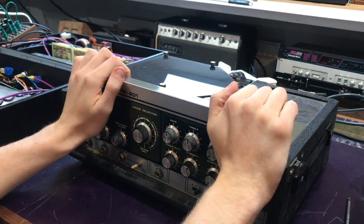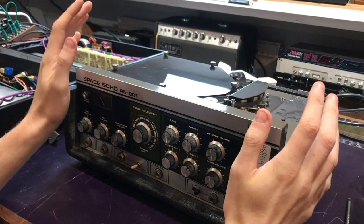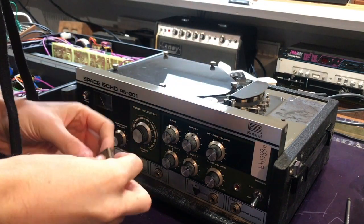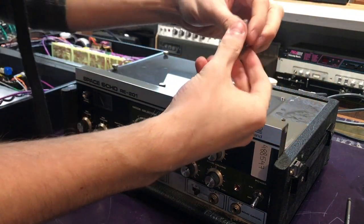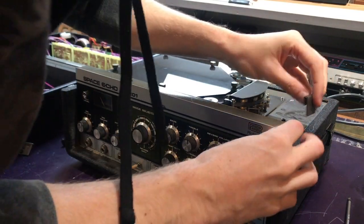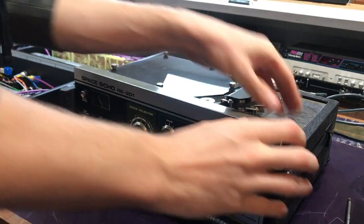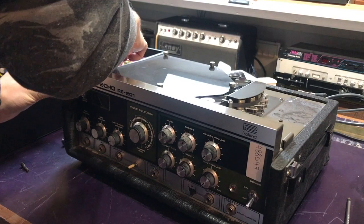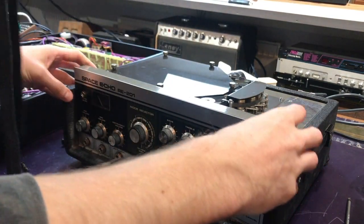Sometimes you might have to push them back basically, just before you start lowering down, so make sure they're nice and out of the way. You want to start by putting the brackets back on again and then the bottom screws. The brackets face inwards this way. It's good to line them both up in position before you start screwing them in, otherwise you can sometimes find that you lock it in a bit too tight on one side and you can't angle it up on the other side.